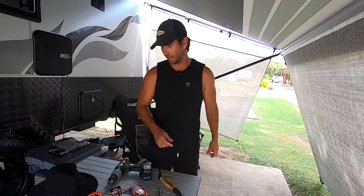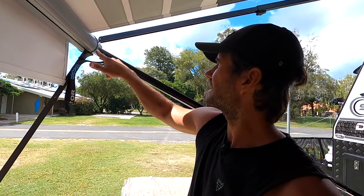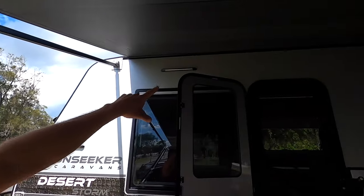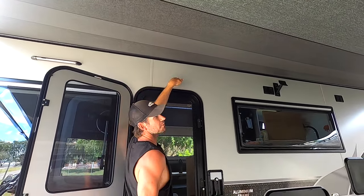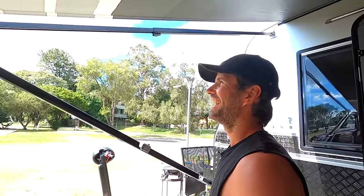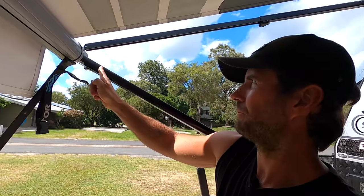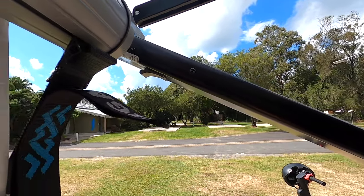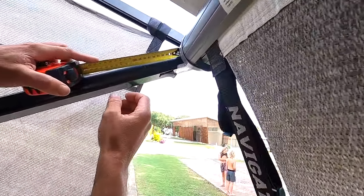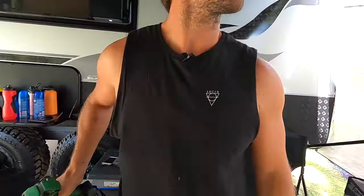Here's where it goes — I've drilled one hole already so you can see. A couple of tips: make sure you don't put it too far down the leg, because when your awning is rolled back up, the clothesline needs to clear the top of the door, otherwise you won't be able to open and shut it. We learned from experience! On this van, 85mm down from the barrel works, then drill a 6mm hole in the centre. Mark the same on the other pole.